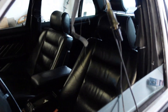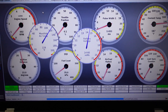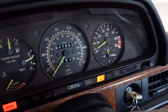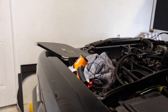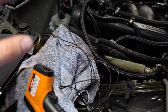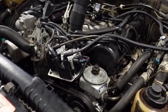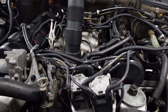The car is running — you can see it there. We got the tach working too; all I had to do was connect the tach-out wire. It's running pretty good; it's got a little bit of a rough idle that I'm sure I can clear up with some tuning.